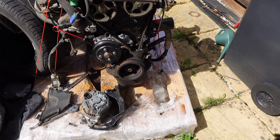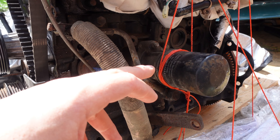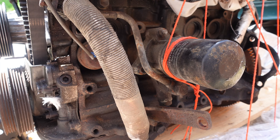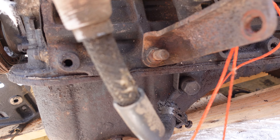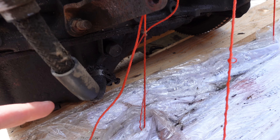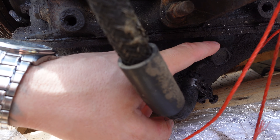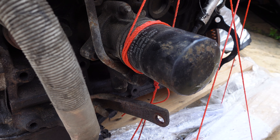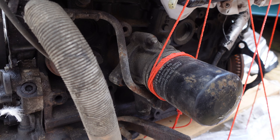What we're doing today - at least for the first part of the video - is definitely taking this off. From what I can tell, it's for an oil cooler. I think what I can do, and this is for an MR2 Mark 1 so I'm not 100% familiar, is take off this bracket here, take this out - I know this is a bung and it's probably got a banjo bolt in it - and just put another bolt in it and take off this whole unit. I would imagine underneath here is just a slot for a normal fitting because it's just a basic engine.